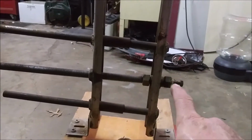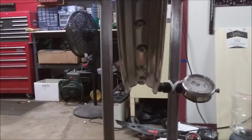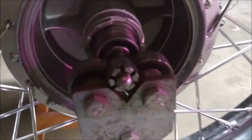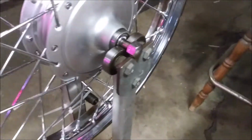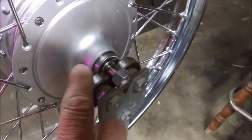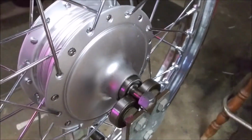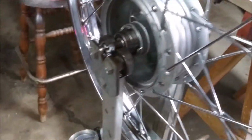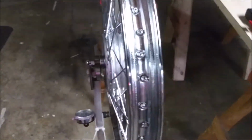It's adjustable. You adjust the screw and you can widen or narrow your uprights. The uprights go onto a couple of bearings he has here. Get some light on there. There we go, see it? So he has the two bearings here. So my axle, a couple of bearings for shims, and that holds everything in place for me, so I don't have any side-to-side movement.